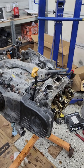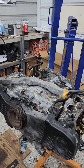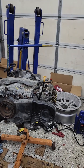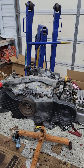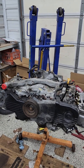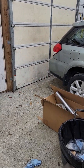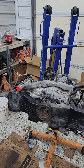Hopefully this will help anyone out there with an older Subaru struggling to find a motor, because the prices are just insane. You can get the 2010 and up motors cheaper because the transmissions and valve bodies go out in those all the time and nobody wants to fix it, so the motors are easier to find and cheaper — and you can make them work. We've done this once before and figured I'd make a little video. If you have any questions, just put them in the comments and I'll try to get back to you.